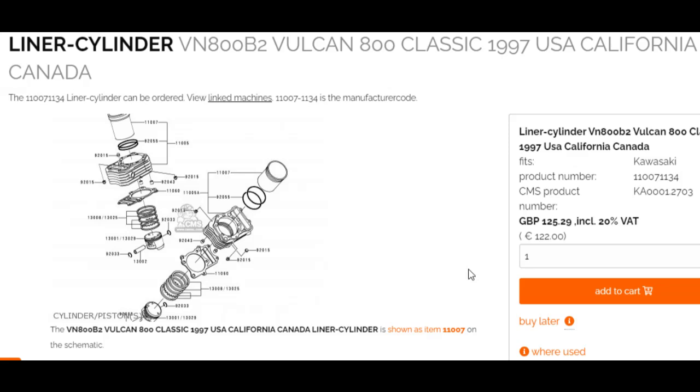And the cylinder liners can be swapped with just a shop press. You can just push them out of the cast cylinder assembly and replace them with a fresh cylinder liner and a couple new O-rings. So should you need to, it's not that bad.